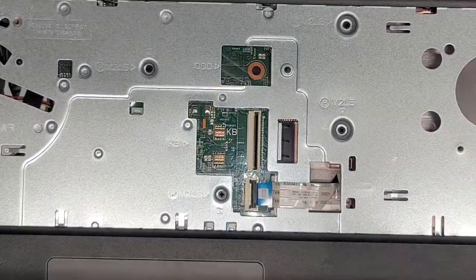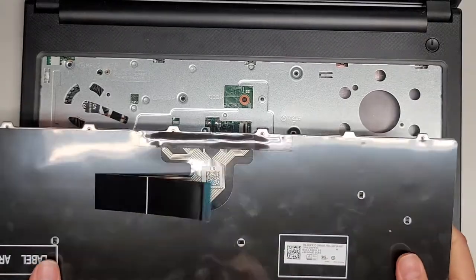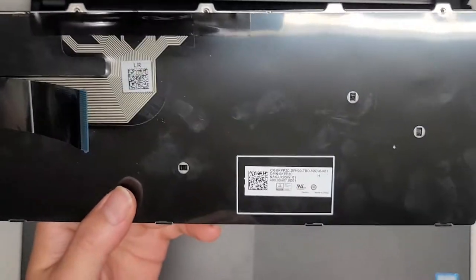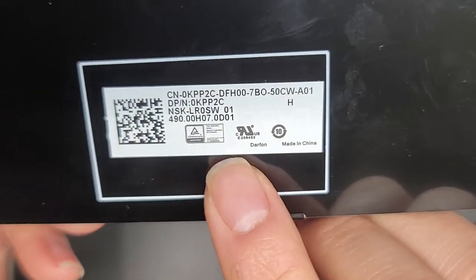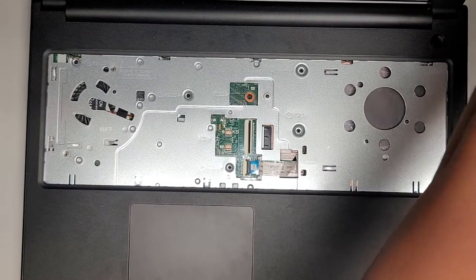Here's the keyboard. There are actually no screws on the back of the keyboard, so if you just need to replace the keyboard, you don't need to remove any of the bottom screws. You can remove the battery to be safe, but usually you don't need to. There's the keyboard model information — if you want, you can look that up on eBay or sometimes find it on Amazon.